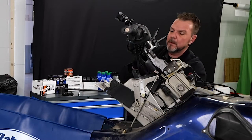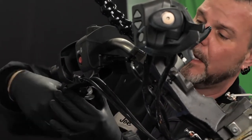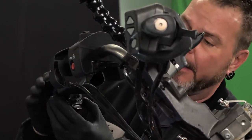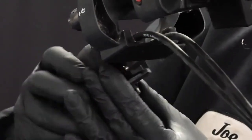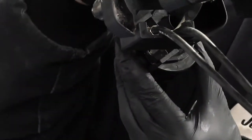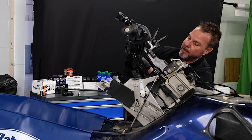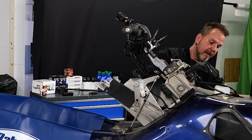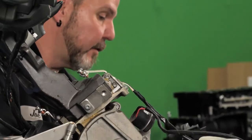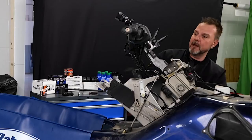What we're removing right now is where your cables are going to go — you can see how they wrap around, allowing movement of one cable relative to the other depending on the way you twist. One thing you'll notice: these are pretty dry. Some of your pivot points are right here, not the cable itself. We'd use a little bit of silicone here as part of normal maintenance. We're replacing the cables anyway, but take a look — there's dirt and debris in here, so we'll clean this up and use silicone on the pivot areas.